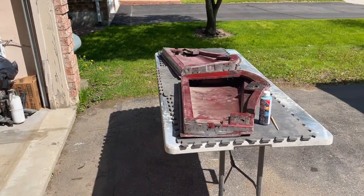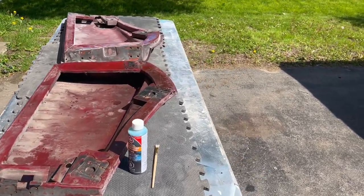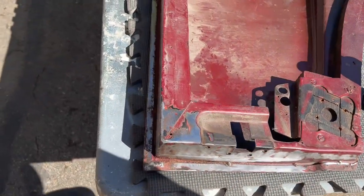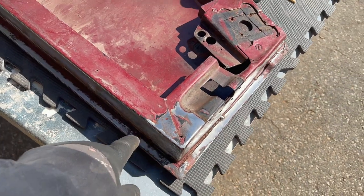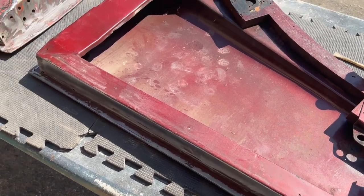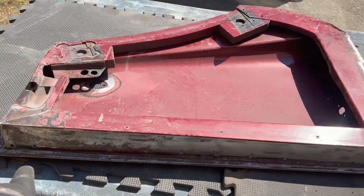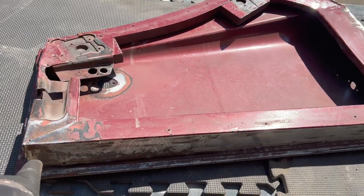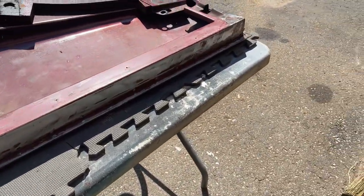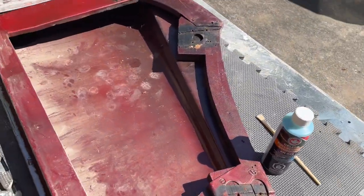Today I thought I'd start working on the actual doors and getting ready to do some body work on them. The first thing I wanted to do was apply some rust remover gel. We're going to do a little coating along this bottom flange piece on the door skin just to get rid of any rust pits that might be there. We'll also do a little coat up in here — you can see some surface rust — so we'll get that gel rust remover working and then start having a look at these doors as far as body work is concerned. They're not too bad.